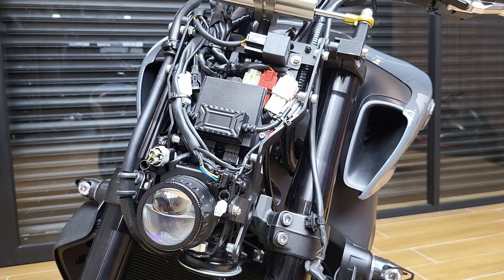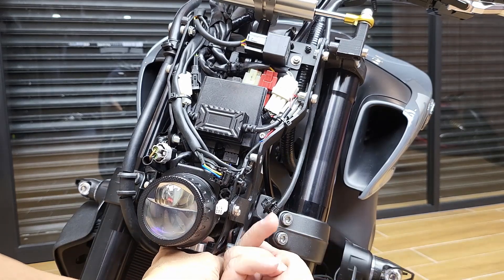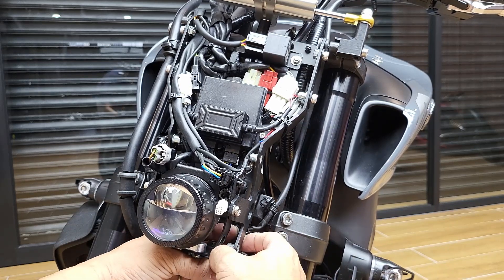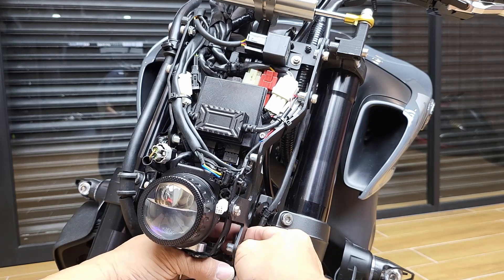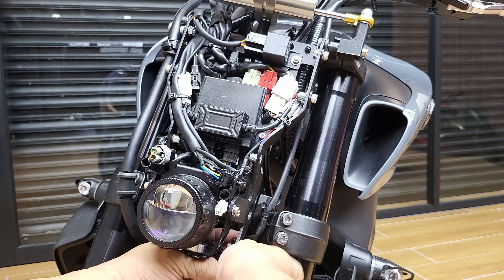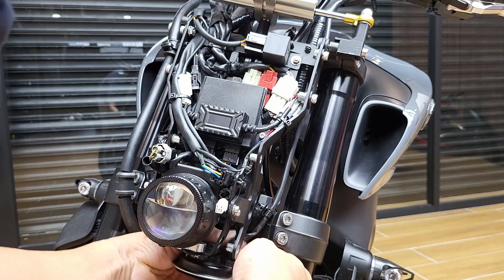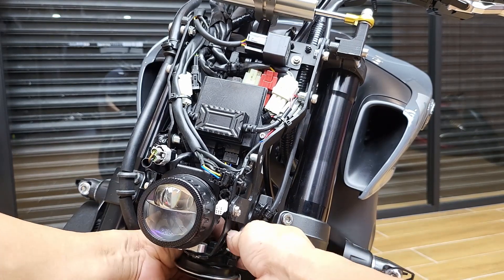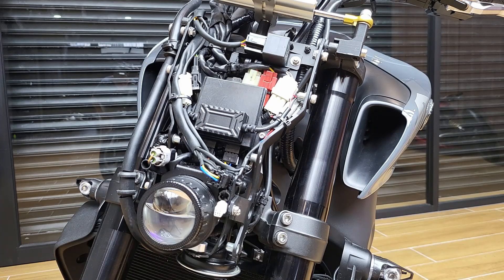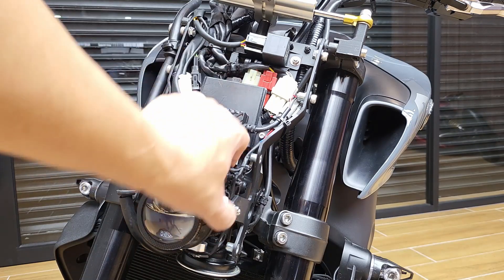The installation should be done. Oh yeah — we've got the horn socket wires which we need to put back. Do not forget the horn. Should have put it in before. It's a bit hard to put in now, limited space. Okay — one is in, second one is in. Socket it down. The installation is done. Just put back the front cover and don't forget to connect back the DRLs. That's the full installation.